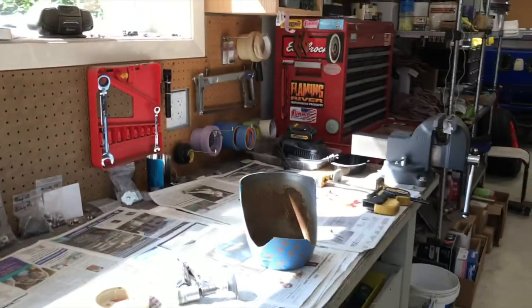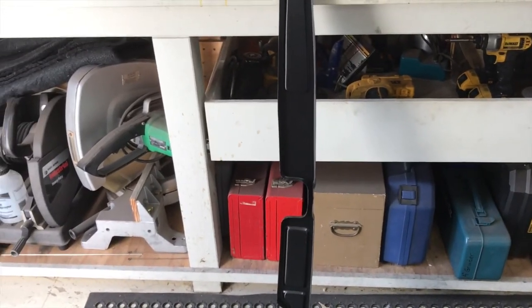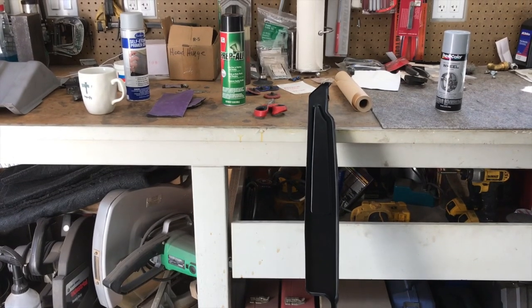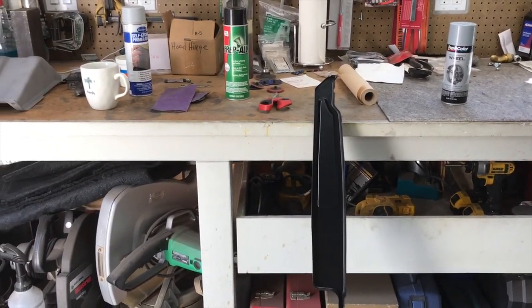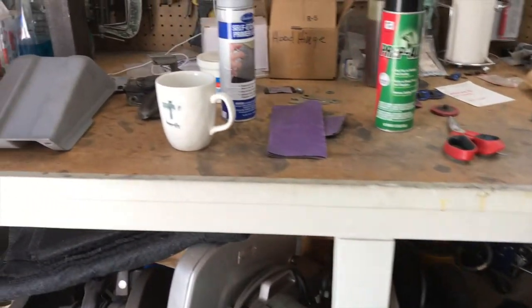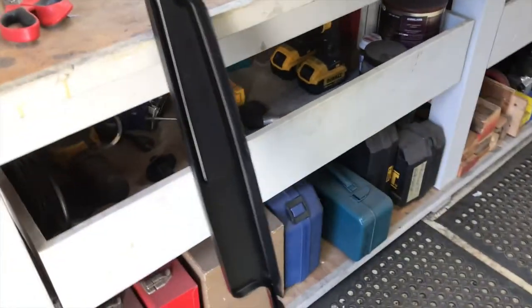Like I said, I'm going to paint those. I have a new brace for the center of the hood, right here. When we move the radiator to the front of the core support, it changes the position of the radiator hose to the center, so the brace that used to be in the hood is off to one side. That little notch right there is off to one side. So this brace is made to accommodate that rather than modifying the other one. We bought this new one, and so that's got to get painted. That's just the way it comes from the manufacturer.